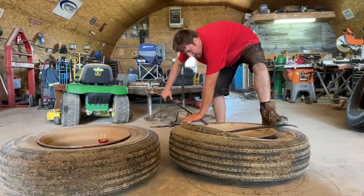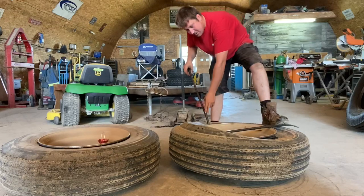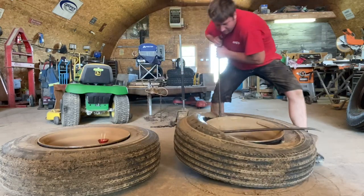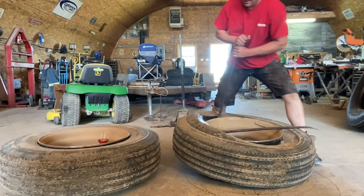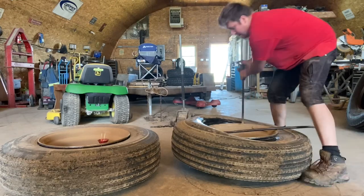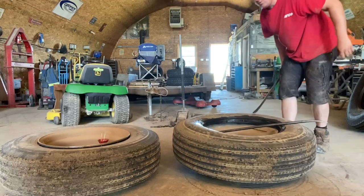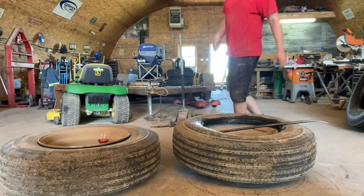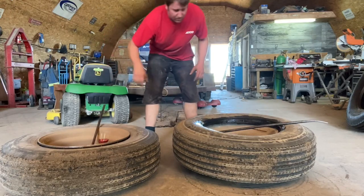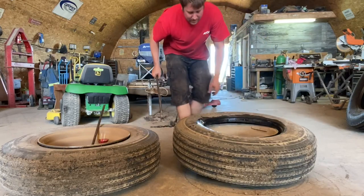Then you're gonna go right back to where the tire isn't off the rim yet, just over from where you just bit. And then you're gonna go over it. And you're gonna keep working your way around until that whole side of the tire is off. Okay? Then you're gonna put your straight spoon bar down. You don't need it. Lift up on the tire, pull your gooseneck out.